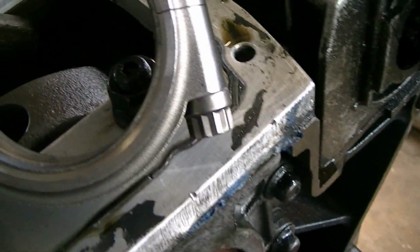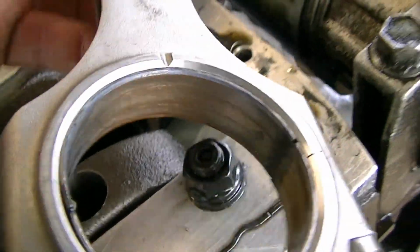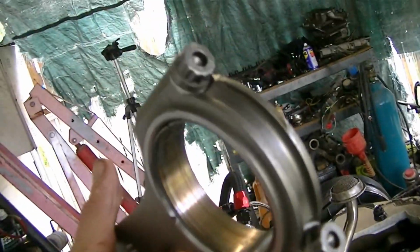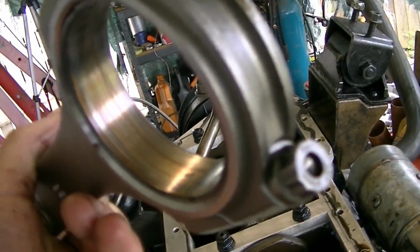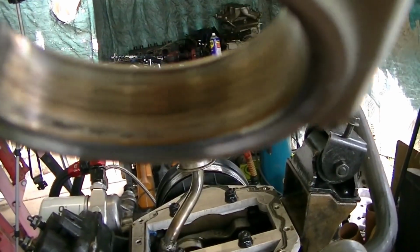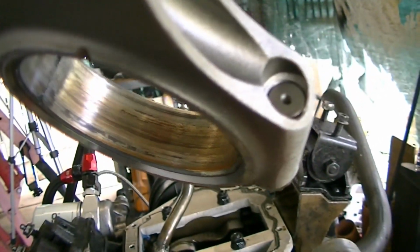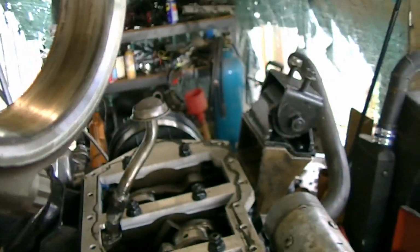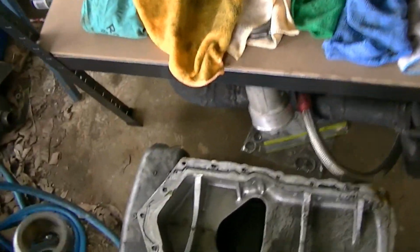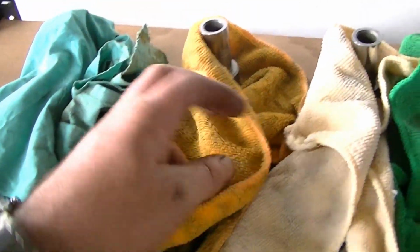If you can see that, I mean, they're crushed and distorted. So you can also see the brass on them. I know it's difficult, the lighting in here is horrible. But yeah, it's pretty bad. I mean, yeah, you're gonna have to take my word. So number 3 was about to spin a big end, so I got lucky,